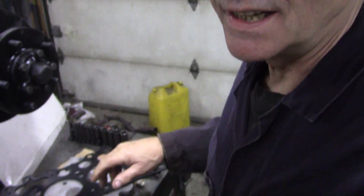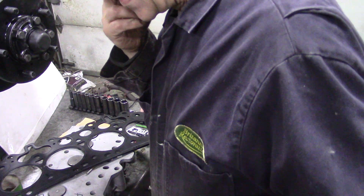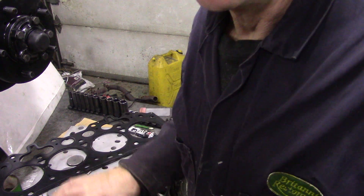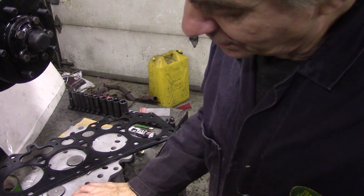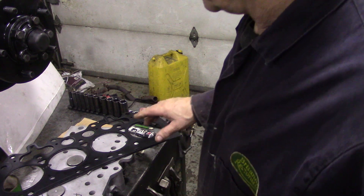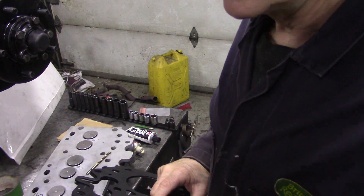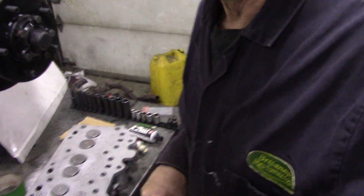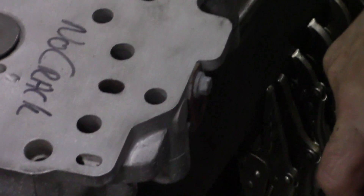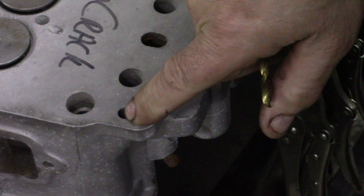So what's the big deal? Well, let's step back in time and have a look at a 200 TDI head — this is the only one I've got left. It's got the tiniest hairline crack between two of the valves, but it's perfectly flat and we tested it up to 130 PSI with no leaks. It just needs a seat cutting, but it's on the shelf. When we look at the head in detail and zoom in, you can see it's not just a drilling — it's a slot.